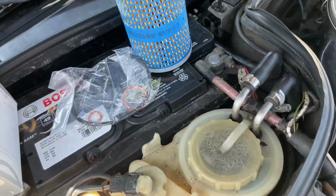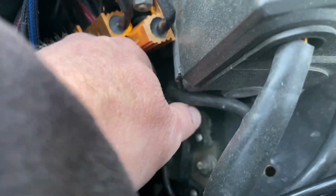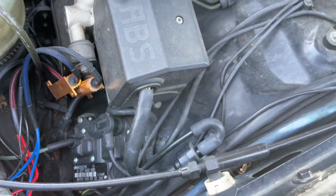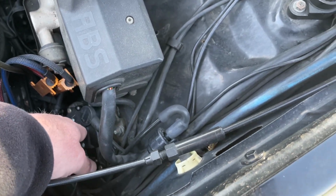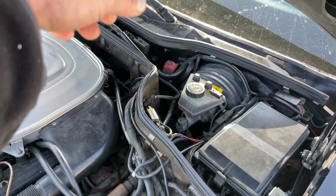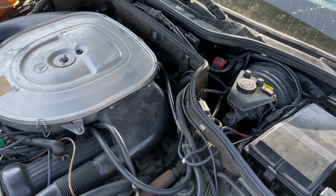And the other thing is this: when you use heavier oil, what you probably want to do is to remove the rear crank position sensor, which is this cable here on your EZL, this one here. And this will prevent two things. It will prevent the car from starting. You won't have any ignition. And this crank sensor goes into the EZL and creates the TD signal, which goes to the fuel pump relay, the idle speed control unit, and the ECU. And let me see, was there another item it goes to? No, I think that's the three it goes to.